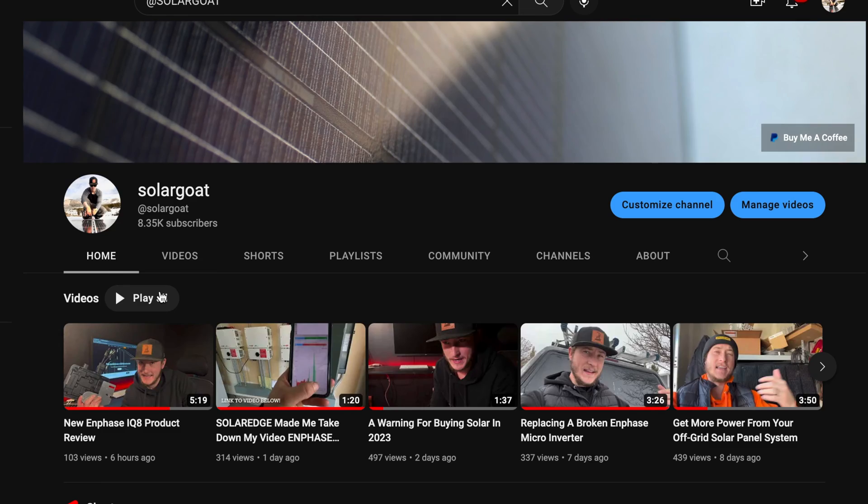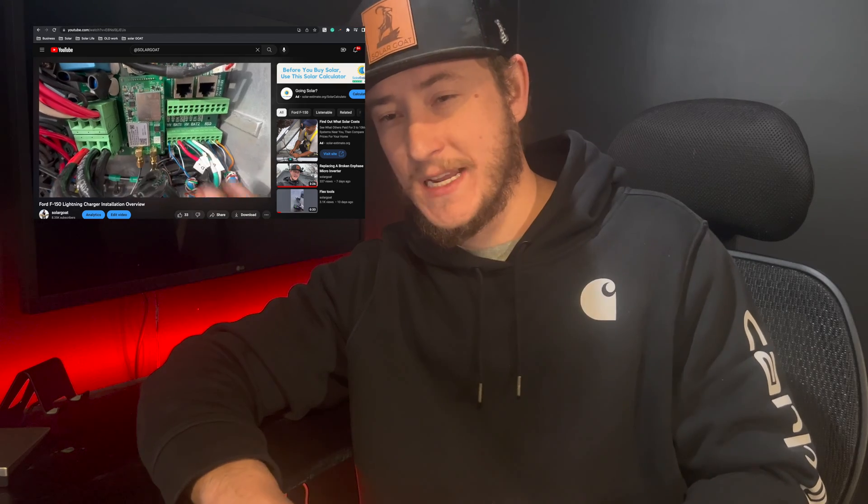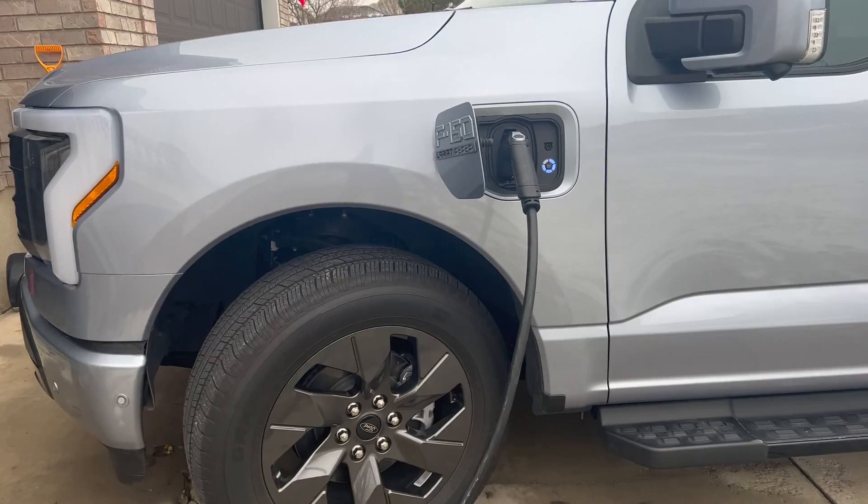It's only a matter of time before hopefully all electric vehicles will be able to have some of these functionalities, but Ford is jumping in as one of the first to really have this option standardized and available. In order to utilize this feature, you do need to install the products that Ford worked with — Sunrun and Delta. I have another video linked below that goes over a more detailed overview of what this installation looks like. The only complaints I would have when installing the home integration system: there is very limited tech support and resources for that whole product line for doing the intelligent backup, and there are some software issues, especially if you're doing this kit without batteries or solar panels. So that's just my honest opinion — beware.